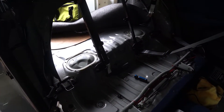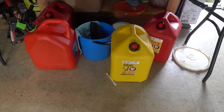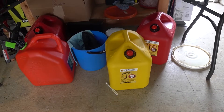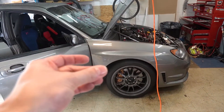And back here I had to drain fuel, so that's why that's all taken apart. If you look down here in my messy garage, you've got four cans of ethanol — that's what it took to get this car empty, because I actually had the thing full. So right now we're on 93, because you tune on 93, then you switch to E85, you tune on E85, and then flex fuel happens.